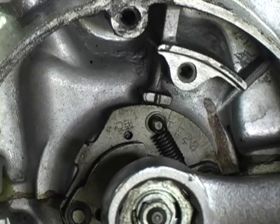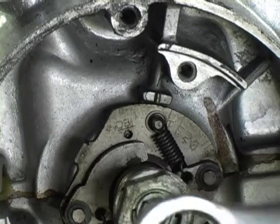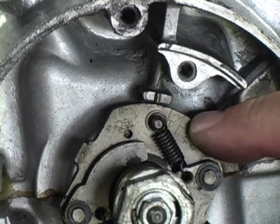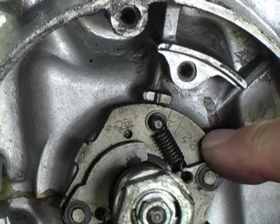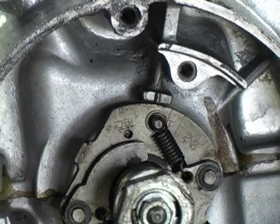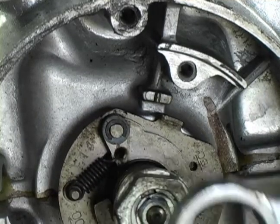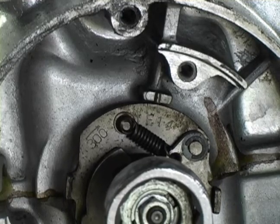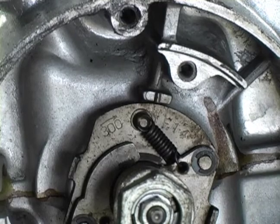What you're looking at is a close-up view of the ignition cam and spark advance mechanism where the timing marks are located on this Honda. The T represents top dead center. F is the ignition timing mark, which we'll cover in the point timing segment. The 2,3 means those are the marks for center cylinders number two and three. The cast mark on the block is the reference mark that tells us what to line up with. Now that the intake valve is on its way up, I'm slowly rotating through, looking for the T mark for cylinders one and four. We'll slowly bring that up until the T aligns with the reference mark. Now we're on top dead center compression for number one.